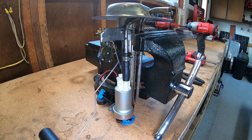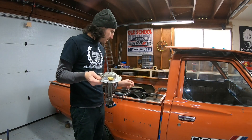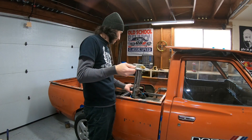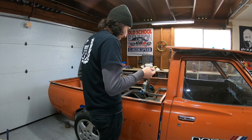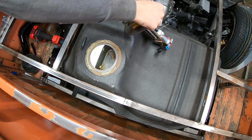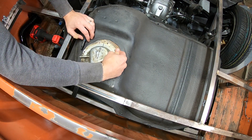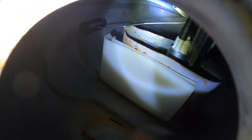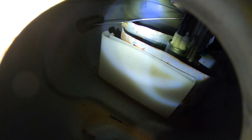That's just about perfect. The last step is to fit this into the gas tank and peek through the fill hole to see how it's interfering with the baffle. Looking through the fuel fill plug, the float wasn't touching the bottom of the tank even though the meter was indicating E — so I bent it off camera so we know it's indicating E when it's at the bottom.